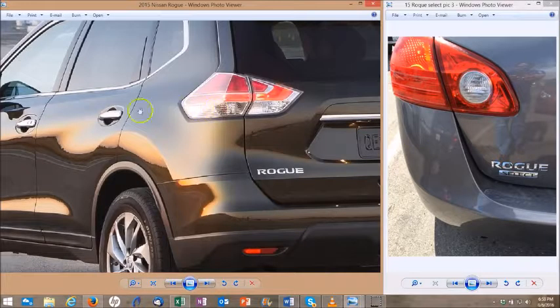That's important because some people work on one of these 20-digit systems and they try to apply the N104PT, and that's not going to work. This is the Hitag 3 on the newer system, and it is a 20-digit conversion. It's not hard to program.